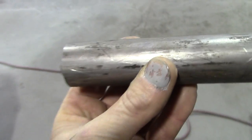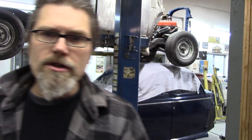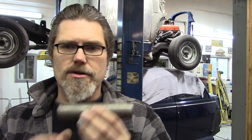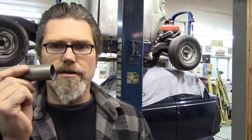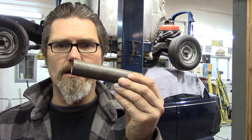That's my little trick there. At the end of the day, you really don't need me to explain all of this on video - it gives you a little visual so you can see what's involved. If you've got a Chevy pickup and want to do this, it's pretty basic. Even though the instructions are for a Ford, no big deal - all you do is go buy a piece of tubing that the barrel locks fit into and weld that into the end of your tailgate up top. Once you do that, it's the same instructions as for a Ford, because now you've made your Chevy round up top. I hope you guys like that tip - give me some feedback, let me know. Sorry about the video quality again; I'm not set up that way and I'm here to work on customer cars. See you later.